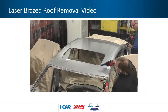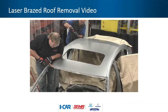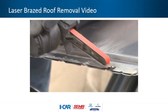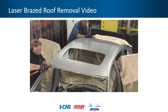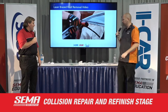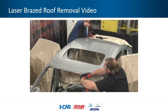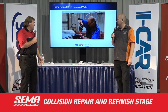Here we're just cleaning the surface, getting all the paint off, and identifying where the spot welds are. The idea is to find the exact center of those spot welds so we can grind or drill without affecting the base metal underneath. We're being really cautious to grind just that top material, not get into the bottom level. The clue I've always seen is: if it just starts to turn blue, stop. If you stop there, you're usually going to be pretty good. If you keep going until that blue goes away, you're now down into the base material for the next panel. Here I'm using a seam buster — grind until you can almost see the circle going around the weld, then break the rest with a seam buster.